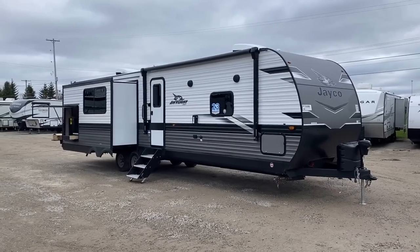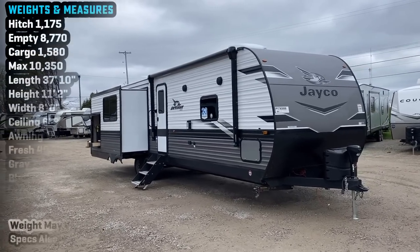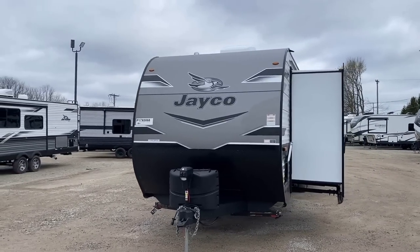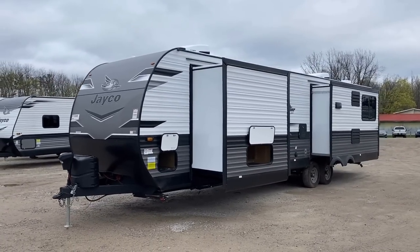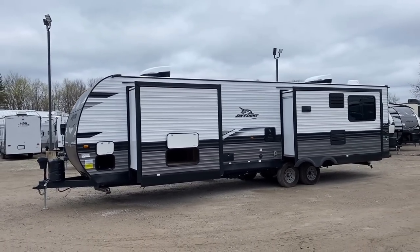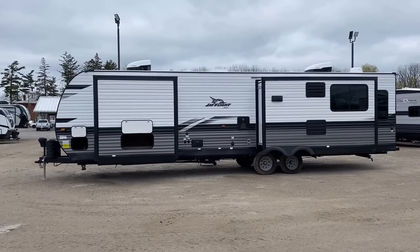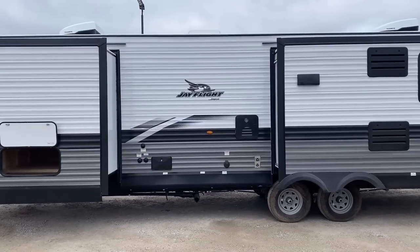Every RV needs a name — let's all get together and give this one a name. People tend to call big ones 'Big Bertha' but let's see if we can do better. Looking at the weights and measures — this is a big rig. Half-tons may struggle, especially with the hitch weight of that big bedroom slide way up front, and the length of this trailer means a lighter half-ton will get pushed around on the road. I recommend three-quarter ton and up for this one. Also notice on the front of the back slide they exhaust the cooking heat outdoors.